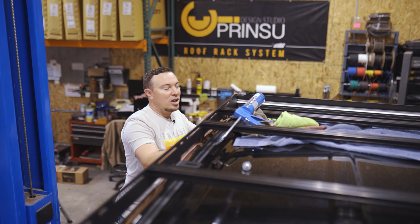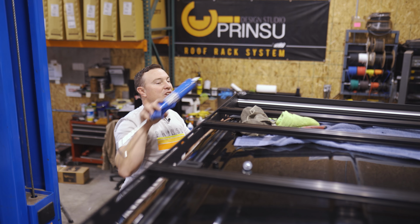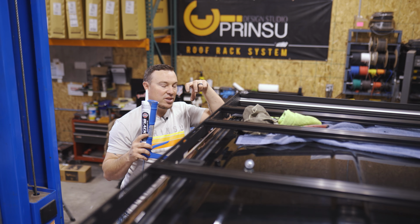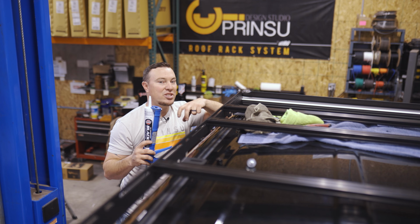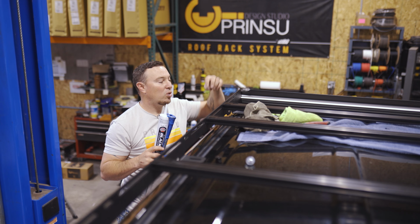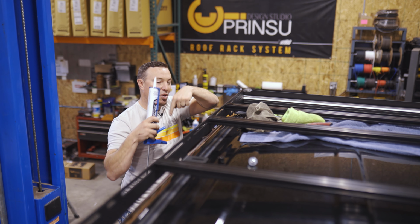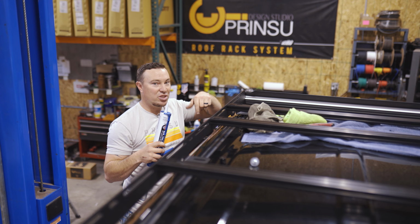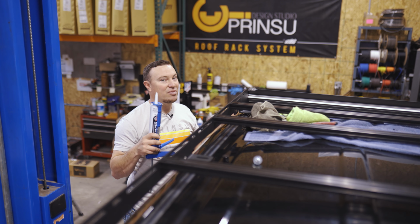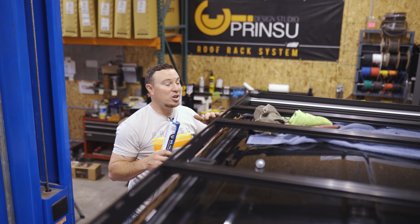All right, so we got our roof rack up here. I've kind of staged our spacers and bolts at the locations where we're gonna need them. We're just gonna mention again our black RTV silicone. So we've sealed the lower portion of the nutsert that meets up with the roof, so we have a great seal on that surface. Now what we're gonna do is fill around that hole and inside the hole, smush that spacer down on top of our black RTV, and that'll really push that silicone around that spacer as well as in the hole, so that when we run our bolt in, it seals all the threads all the way in. This is definitely the way to go. Black RTV, we have 3 layers of sealant on these holes, so we're gonna be great.